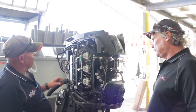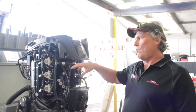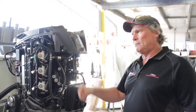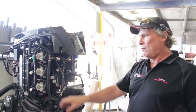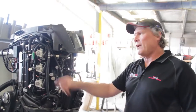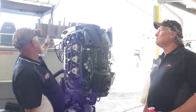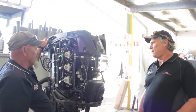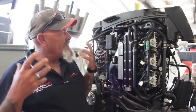The injection system puts fuel directly into each cylinder head, whereas a normal fuel-injected four-stroke has injectors in an inlet manifold — the fuel then has to travel through valves, losing pressure along the way before reaching the cylinder. These injectors operate at extremely high pressure, are more efficient, and you can't get any closer to the piston. That's why these engines have incredible fuel economy and instant power. The bell mouth at the front also eliminates sucking in salt air and draws in cool air. The cowl design isn't just space age because it looks good — it's there for a purpose.